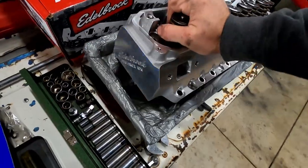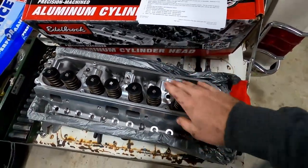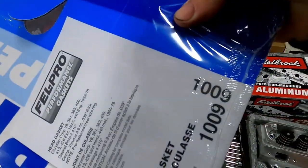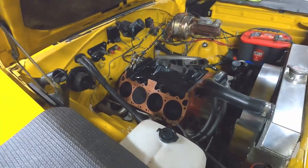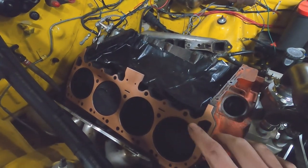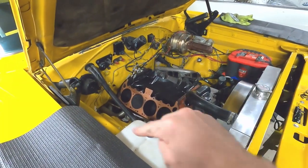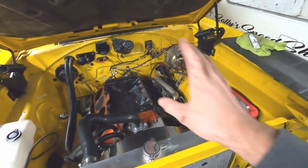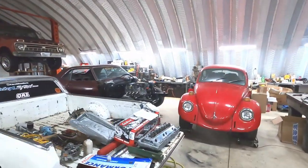Got this thing out of the box. It's ready to bolt on as soon as you pull it out - obviously you want to inspect it first, just make sure there's nothing obvious going on. We're going to be using a Felpro cylinder head gasket, part number 1009, just a basic gasket. Unfortunately I only ordered one, so I can only do one side tonight. I went ahead and sprayed it with some copper spray gasket - I like to do that on cylinder heads just to guarantee a good seal. It's here on the block, ready to receive the new cylinder head.